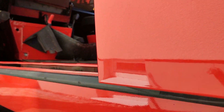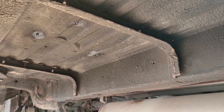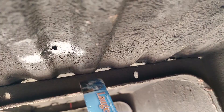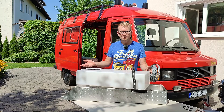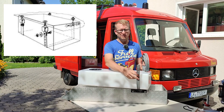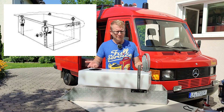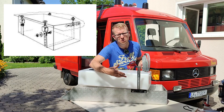Let's have a look under the van to check out where we can install the tank. The Mercedes T1 has a perfect space on the left-hand side, which equals the space of the fuel tank on the other side. We can mount the tension straps over these support beams without drilling any new holes into the chassis. Usually you would drill holes in the floor of the van and mount the tank that way, but that has the disadvantage of requiring new holes and the tension straps pressing into a very small area of the tank, which isn't ideal.